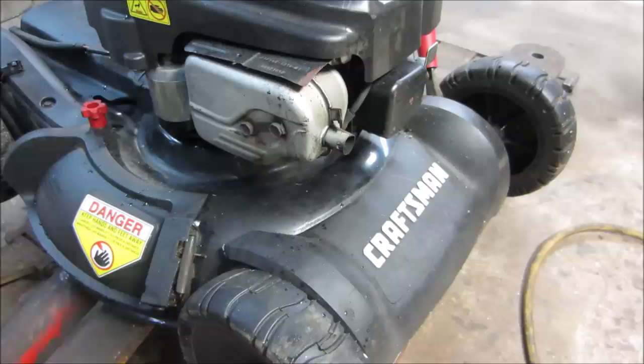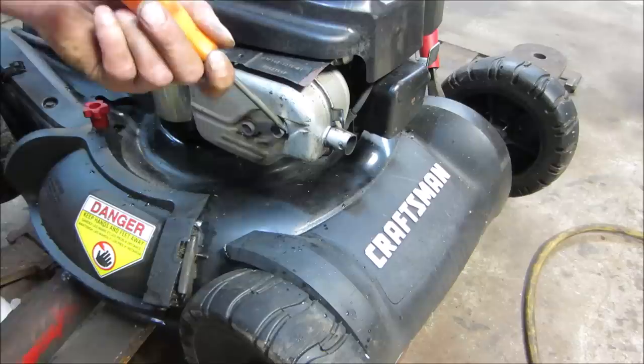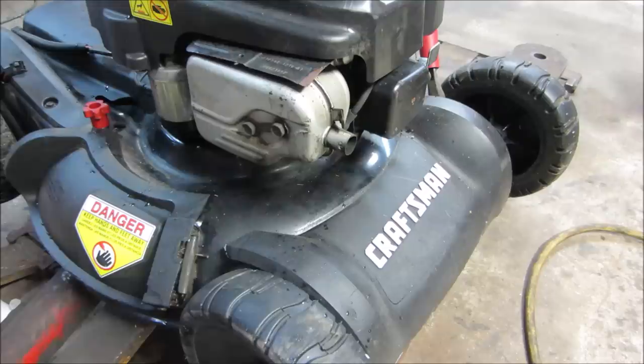Sometimes when you see exhaust bolts loosened up, it can be an indication that it got overheated at some point. Not necessarily, but I see it popular on snowblowers. And you say, a snowblower, are you kidding? Using it in the wintertime. They get mouse nests in them, and they're not cooling, so maybe they get baked.